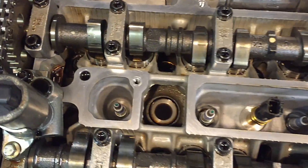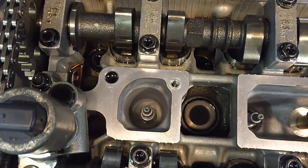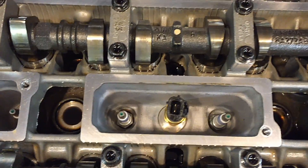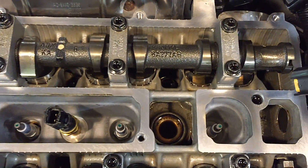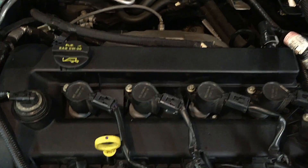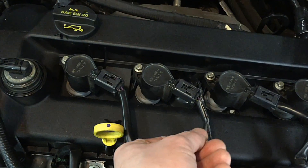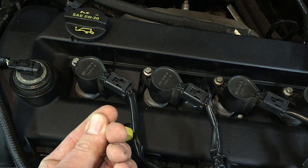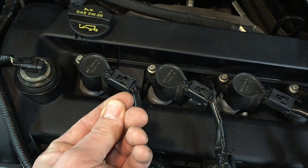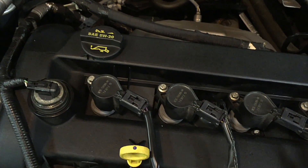This is how it looks down the spark plug well — see how they're nice and clean inside, nice and dry. That's how they should be: no oil, no coolant, nothing down inside — not even a seepage, because that can cause a misfire. It's a very easy check. All you have to do is pull the one bolt out, pull your connector off, pull the coil out, and look at the end of the boot. You'll be able to tell right away if it's oil-soaked or not, without even sticking a light down in there.